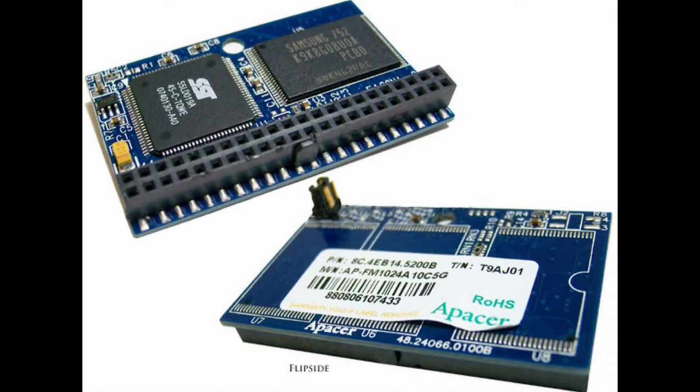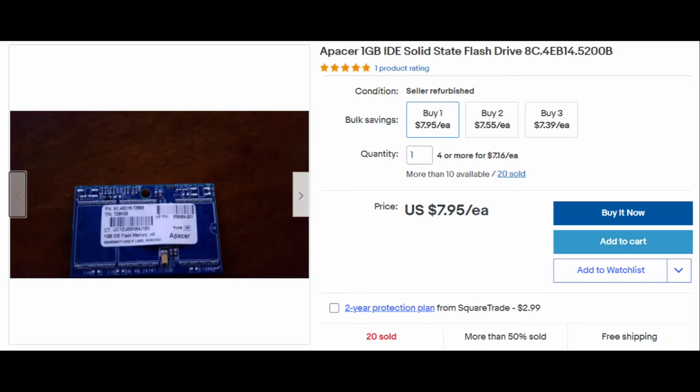It actually comes with a really small disk-on module for storage, but you can upgrade that, and I actually suggest that you do. I'd probably go with a 1 gigabyte module or greater. They have to be horizontal like you see here, and you can readily find them available on eBay. Here's a picture as well where you can see something that you can find. This particular seller has a lot, so you could get one.